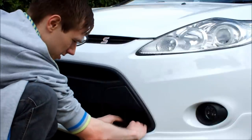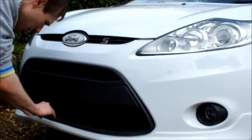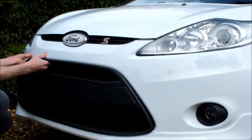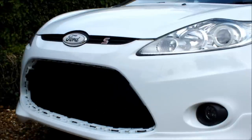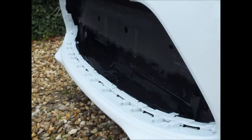Step one is to remove the existing grille from the car. To do this I usually start in one corner, place my fingers through the holes on the front of the grille and my thumbs on the bodywork of the car. Using a reasonable amount of force I'll then work my way all the way around the edge until I've completely removed the grille. It probably looked quite easy in the video but that's purely because my grille has been on and off a few times. The first time you do this you may find it requires additional force. The only thing I can say to reassure you is it's a lot stronger than it looks, so don't be afraid of breaking anything.